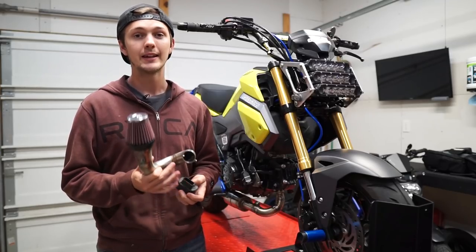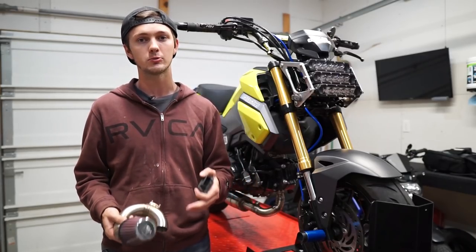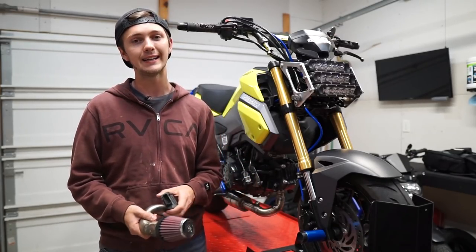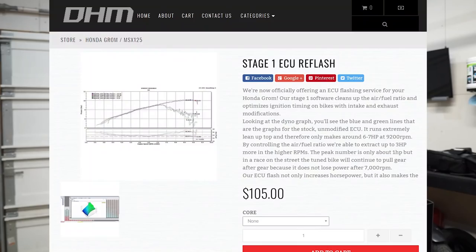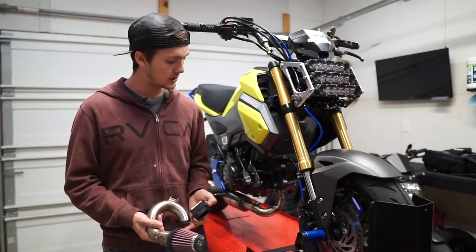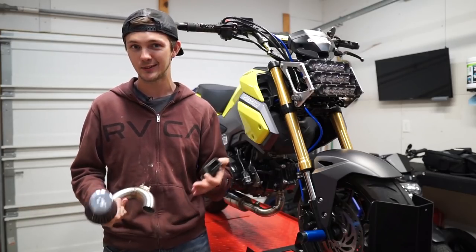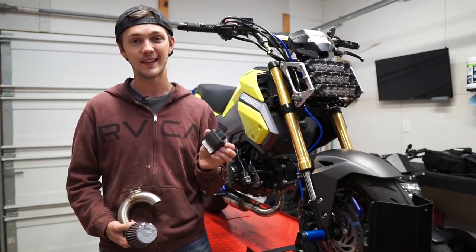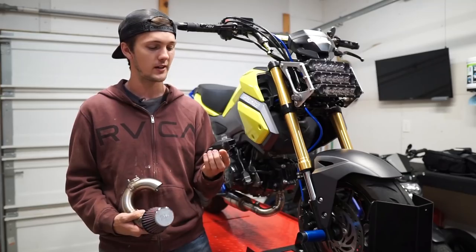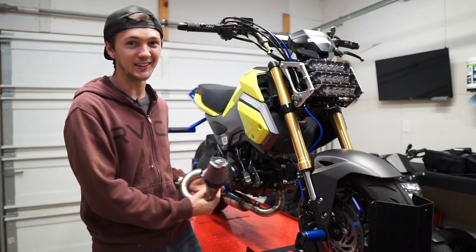So I'm hoping that same thing applies to the Grom. Now, with installing an intake and an exhaust, your stock ECU is not going to run very well — it's going to run lean. So you're going to need something to tune it, or in my case I got a tuned ECU from the guys at DH Motoring. Big shout out to them. I reached out and told them what I was trying to do. Justin, who's in the racing scene, said these guys are legit. They can retune it if I find something needs to be adjusted. The intake is super awesome and I love the exhaust so far.